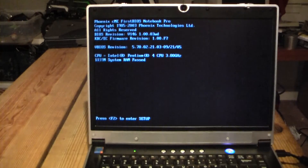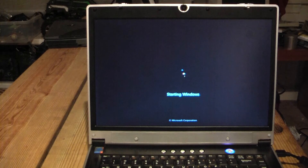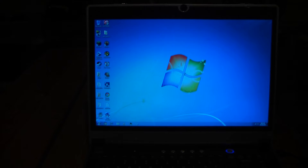I will go ahead and let it boot up and tell you the full specs as it does. This has an Intel Pentium 4 570 processor running at 3.8 gigahertz, 1MB of cache, and it's got 2 gigabytes of DDR1 memory. That is the biggest limiting factor, I think, because it runs pretty good, but having only 2 gigabytes of system memory is detrimental even on a 32-bit Windows system. Once it starts up and is running, all the system fans seem to calm down except for the one that's wired to USB.